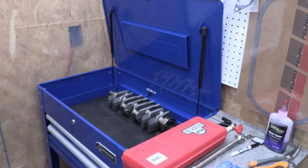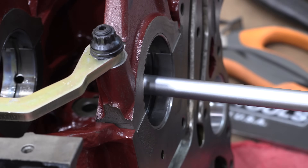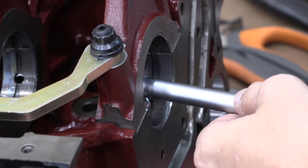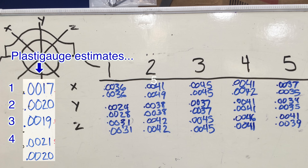Now to inspect the block again, more thoroughly this time. I'm taking 6 measurements on every main bearing journal — two measurements on opposite sides of the bearing, and at 3 angles: one 45 degrees from the main cap parting line, one 90 degrees, and one 135 degrees. I documented every one of them on the whiteboard. Each time I moved to a new journal, I re-zeroed the dial bore gauge to its corresponding crankshaft measurement. With PlastiGage, you saw me measure roughly two thousandths on every main journal — and I fudged the estimates a little bit doing that, which is a stupid thing to do. Only one came in short for how I'm going to use this engine, and I estimated that one around one point seven thousandths.